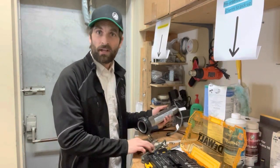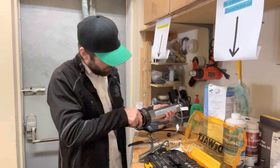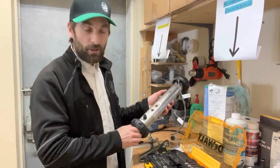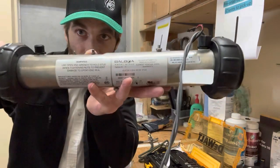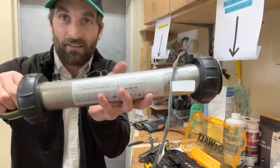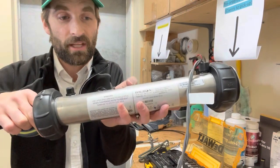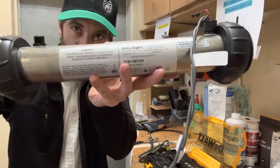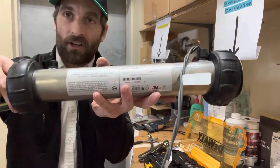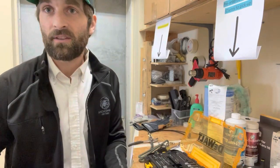When you're putting the new element into the tube, I like to use needle nose pliers to grab the element and help push it past, because as you can see there's a bit of a flat part on the tube here. So you do have to do a bit of pushing and pulling, but not too much — you don't want to harm the new leads. Because of this flat part of the tube, sometimes it's a little harder to get the new element in, but the use of needle nose pliers is best.